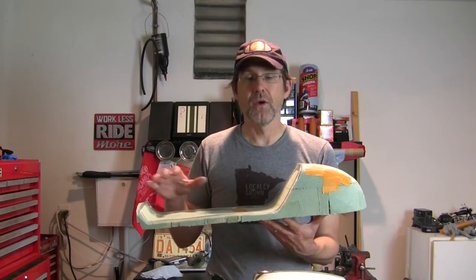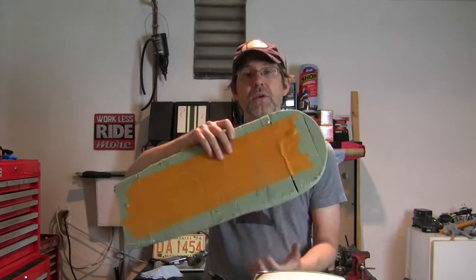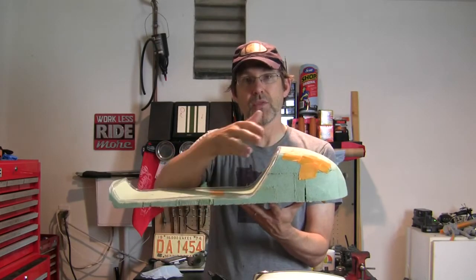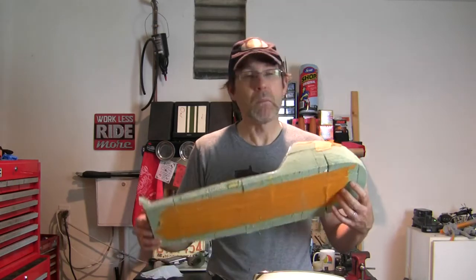So then, once I pull this out of the fiberglass shell — or what is now the seat pan — I can just reinforce that probably from underneath so that I don't continue to build up height any more than this one thin layer of glass. And then just smooth the outside of that. I hope that makes sense, but that's the approach I'm going to take. The other approach is to build yourself a permanent fiberglass mold, and if you want to go into business making these GS 550 seat pans and think somebody's going to want to buy one from you, I guess you could do that.